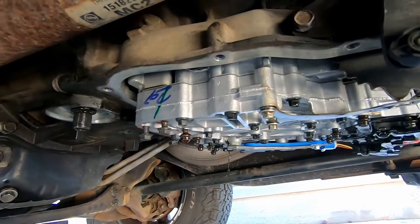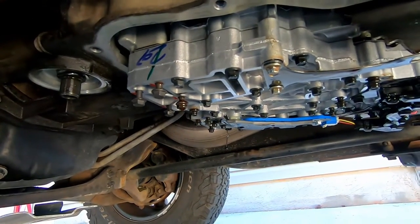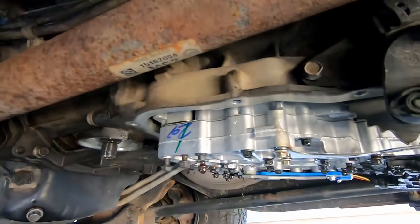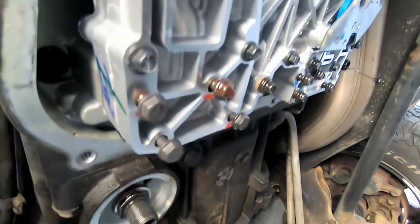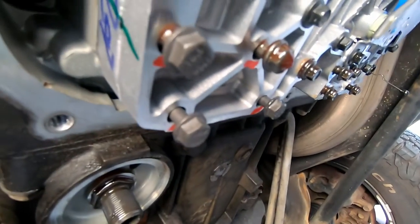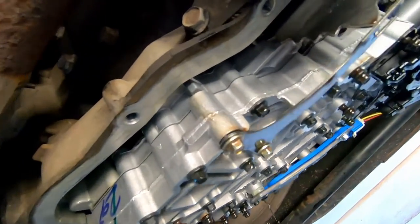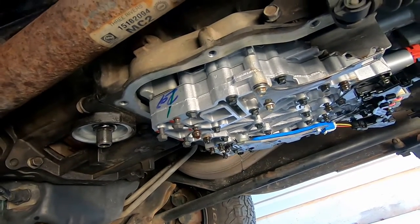You will see we do have the new valve body in place. Pretty simple - just make sure you put the plug in the back, kind of stick that through the hole, then start pushing up because there are a couple of dowel pins you have to get around. Once you start pushing it up and it goes around the dowel pin, it'll get the valve body assembly closer to the transmission. Up front you'll see the four spots marked red - that's the new hardware from Duramax Tuner. The rest of the bolts we're going to tighten down to 9 foot-pounds. We did put the detent spring back on - it does face upward. There are going to be like 14 or 15 bolts total - we'll get them all torqued down.